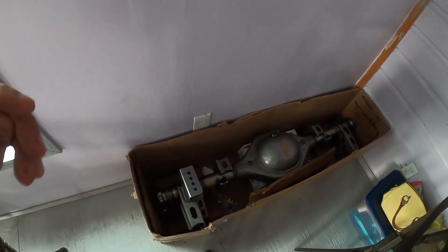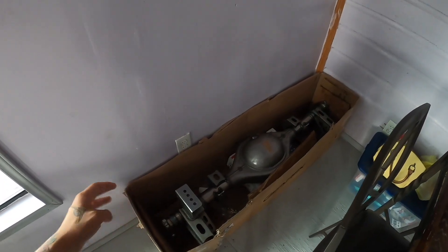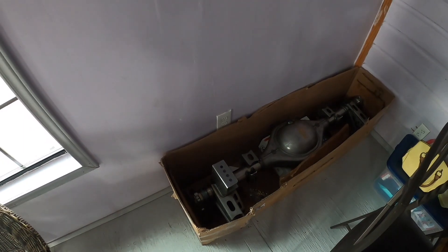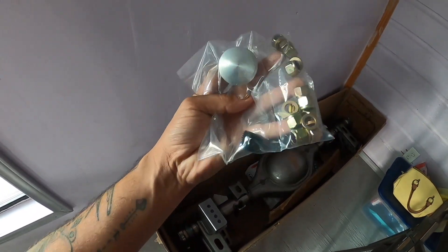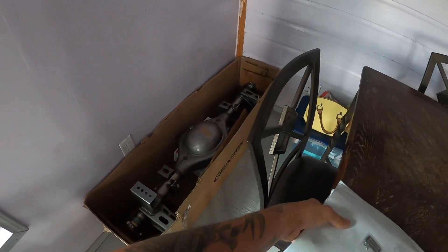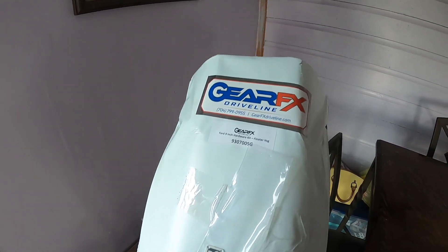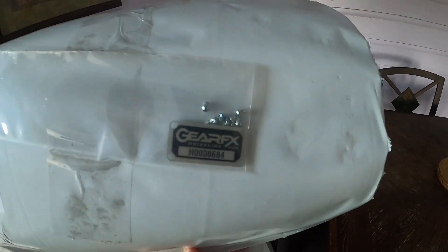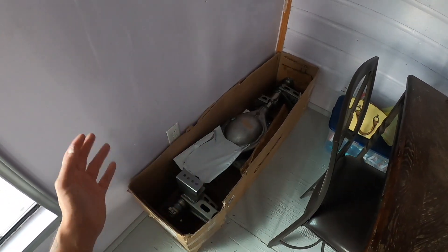I bought it because I want to go towards a pro touring build. It's a floater housing — the actual axle shaft is pretty small and just connects into the hub. You can look up floater housing if you're not familiar. They give you options: bare metal, which is what I got, or powder-coated black. I have PPG industrial paint that I'll paint it myself in black. They also include drain plugs and bolts, and it's made through Gear FX, who builds parts for NASCAR and works with Detroit Speed. This is unit number 684.